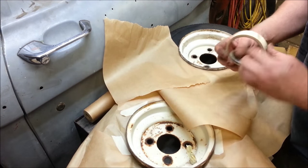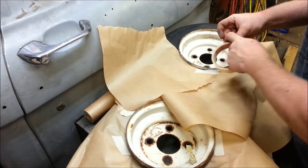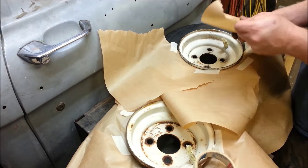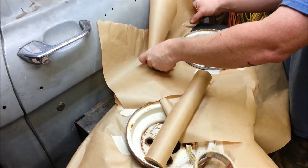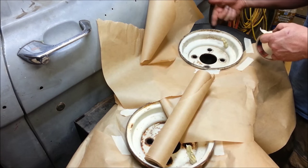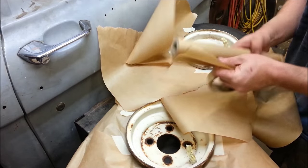This one I broke all the way; this one I just barely nudged — I actually just pushed down with my hands to flatten the tire without even using a tire machine. You can do that with car tires too, just with a bottle jack. You throw a bottle jack under the car, put it on the tire, pop it down, and wedge a screwdriver tip in there just to hold it open. Then you get your paper in there, paint away, and you'll have rims that look amazing.